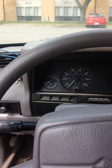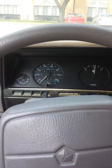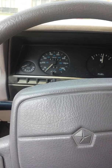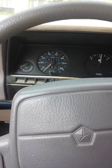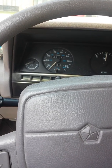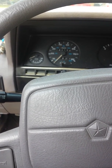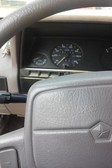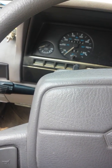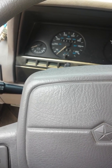Fifty-five means end of messages. It basically means there's nothing else stored. I already happen to know what those two codes are. You would just go online and look up OBD-1 codes for Chryslers. They're all two number sequences. It threw a 35 and a 46. A 35 is the speed control unit or speed control sensor. And code 46 is overcharged by the alternator, which is a code it's going to always throw because this is rigged through a voltage regulator and it didn't originally have a voltage regulator. So the information to the computer about the alternator is cutting off — it's completely cut off from the computer and routed through a voltage regulator.